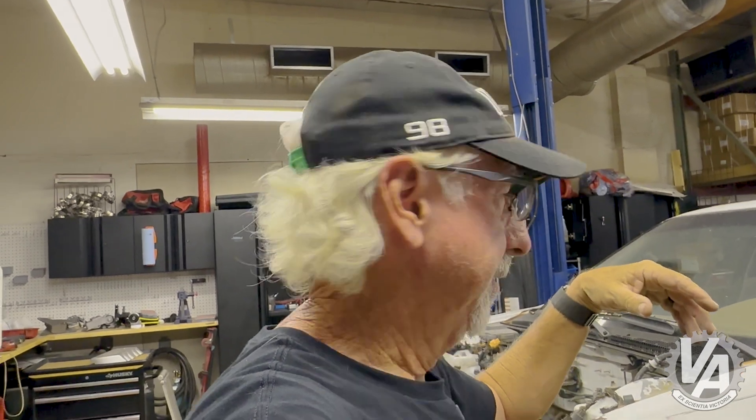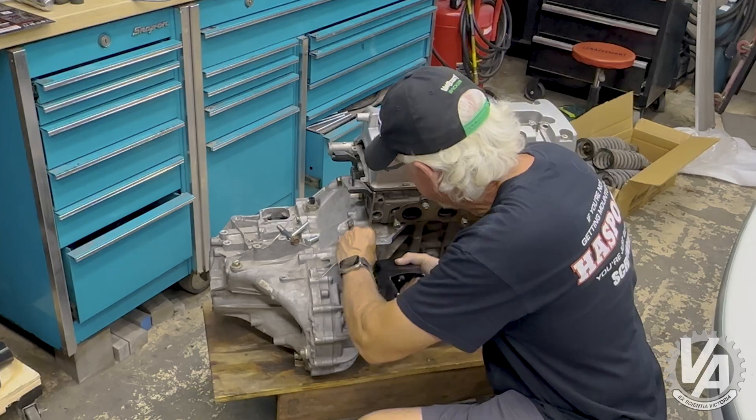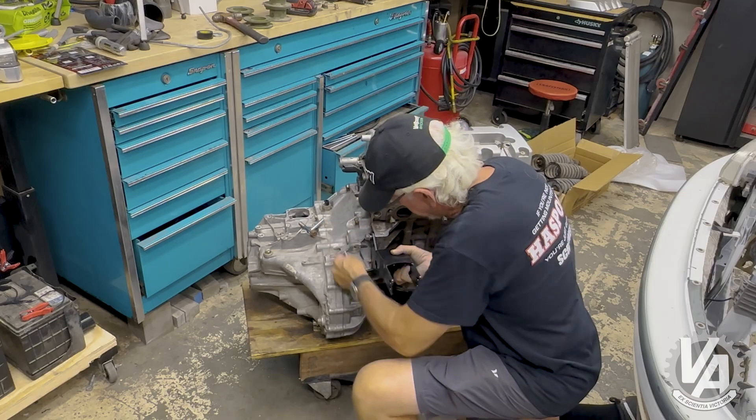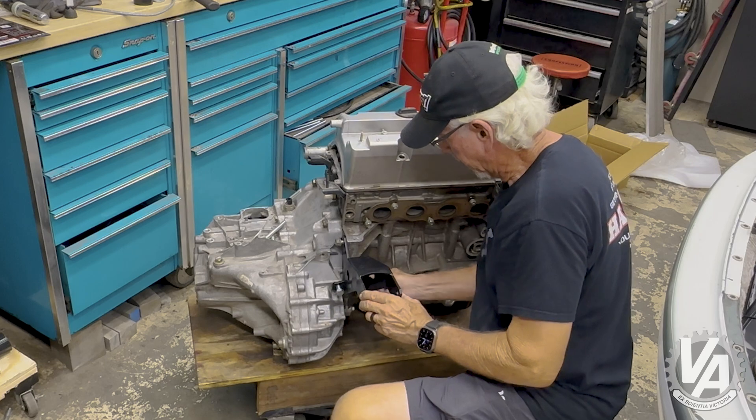Eventually what's going to happen is I'm just going to chop the front end off this car and get rid of the back end because I don't need that for prototyping — I only need the front end. For those of you screaming that I shouldn't do that on such a nice car: it is wrecked, and there are still nice versions of these cars out there. I want a station wagon, not a coupe. We're going to start off installing the rear bracket — basically three bolts hold this on: one through into the block, one through into the back side of the transmission, and one through the block into the transmission. Finger tight.